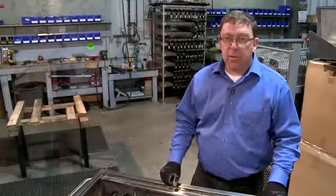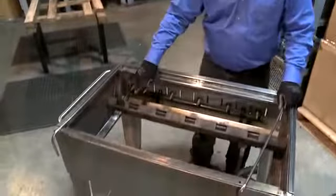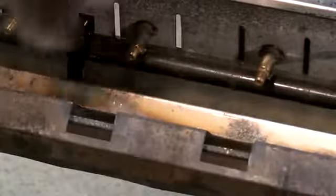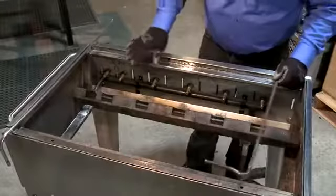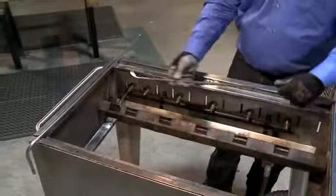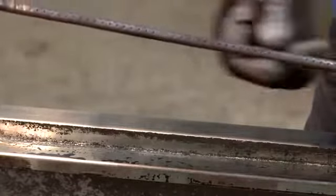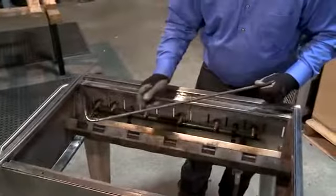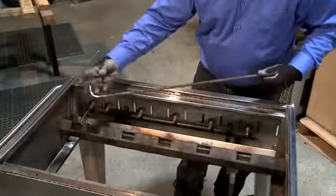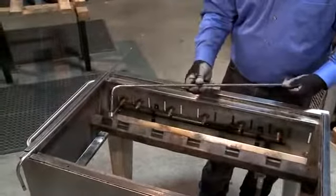Okay, burners are out. Now we can really see what's going on down here. The pilot tube — we're looking at the ports — they're blocked severely. The owner was complaining of an orange flame in this area. This is another tube out of another grill that we took out. Same scenario — all the ports are probably half blocked, and a lot of soot up on this area from that orange, candling flame.